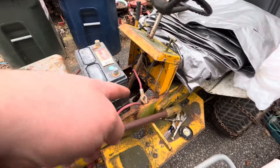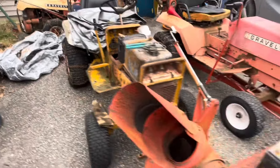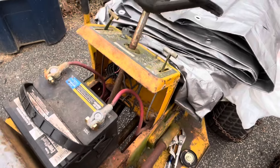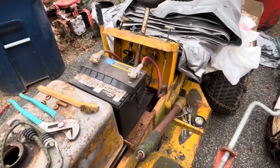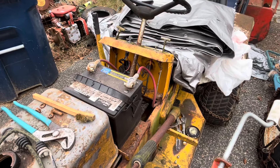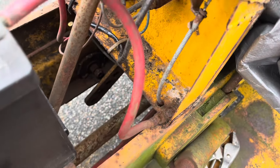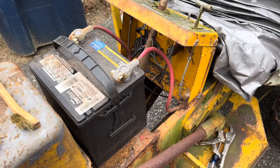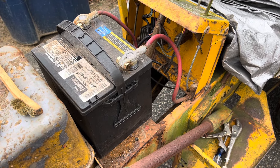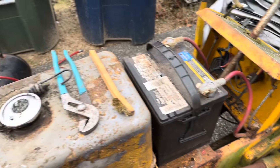Let's take this out, clean these up a little, and put the other battery in. Got it fired up off the battery — no ether — but we do have to fix that rusty connection. There's smoking down there when I tried to start it. I tried to get that bolt out but it's all rusted, frozen, and not a project for 26 degrees out with snow about to fall. So we'll just leave it. If it gets to the point where it won't start, I'll know the problem — probably going to have to cut the bolt or grind the head off. It's just a big project I don't want to get into right now.